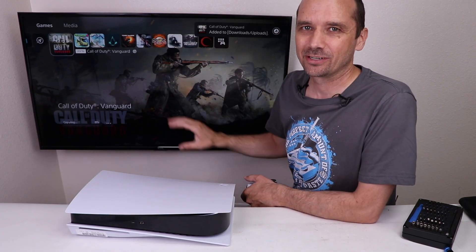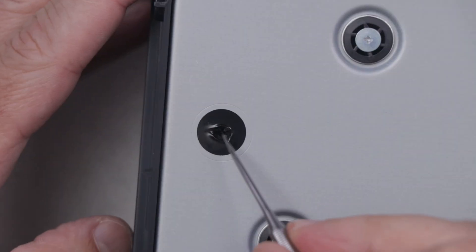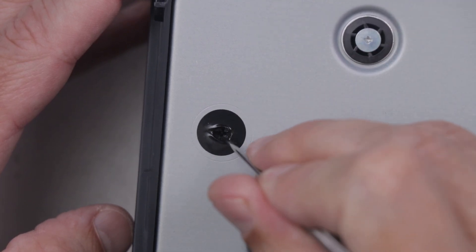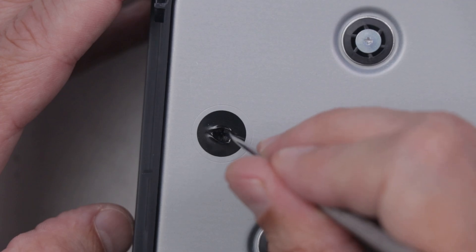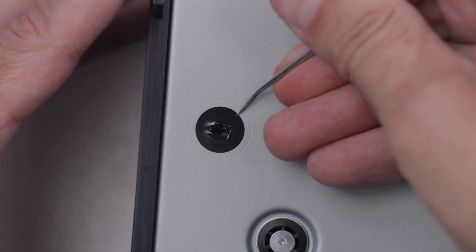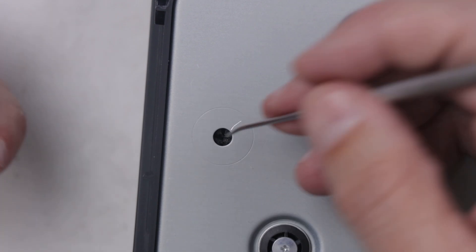It doesn't sound the best, but it is fully working. So we know the disk drive fully works, but it's got that buzzing noise and I think I know why. I've got the cover off so we can access the disk drive. The first thing that can cause that type of problem is this sticker right here — it's a fairly rigid sticker. When you put your screwdriver down here to turn the manual eject screw, this sticker can actually deform inward and stay there, and the sticker will contact these little parts of this plastic — it's kind of like a plastic screw down here. This plastic screw turns very fast, and when this plastic piece contacts it, it can make a buzzing noise. The easy fix is just to remove this plastic piece. And this little tab right here is what was rubbing against it — that's part of the reason for the noise.